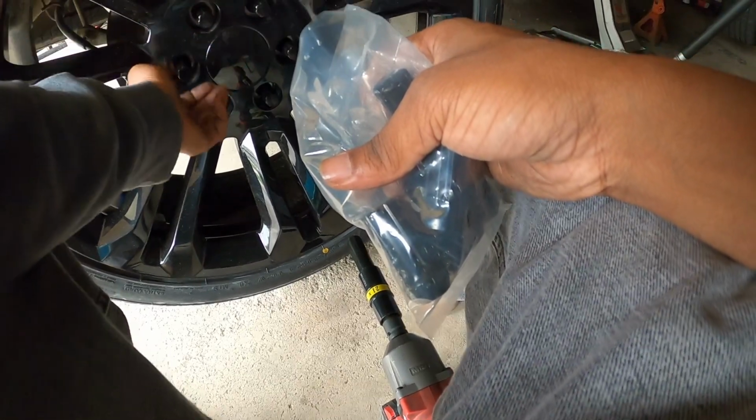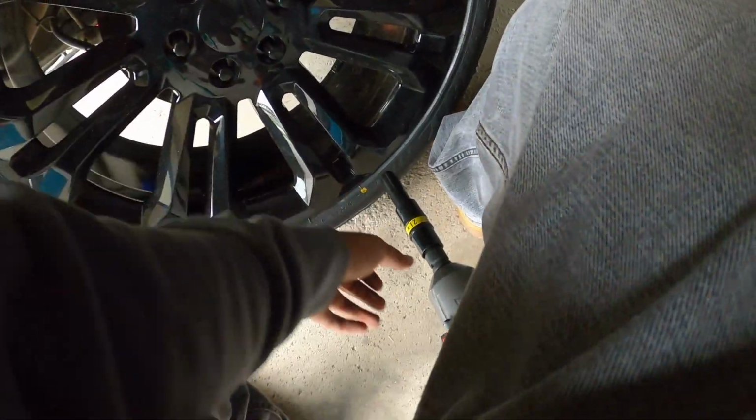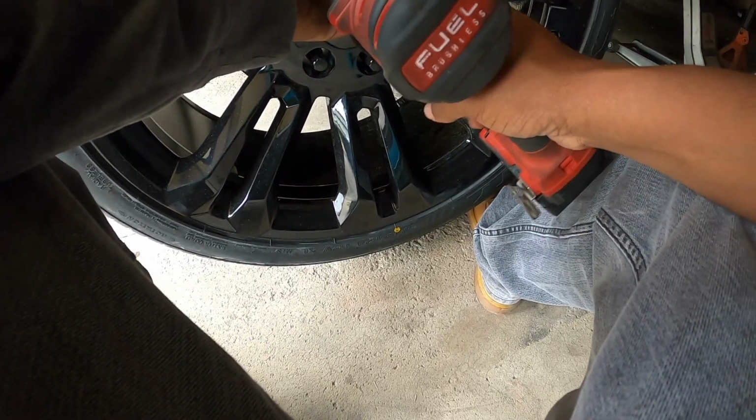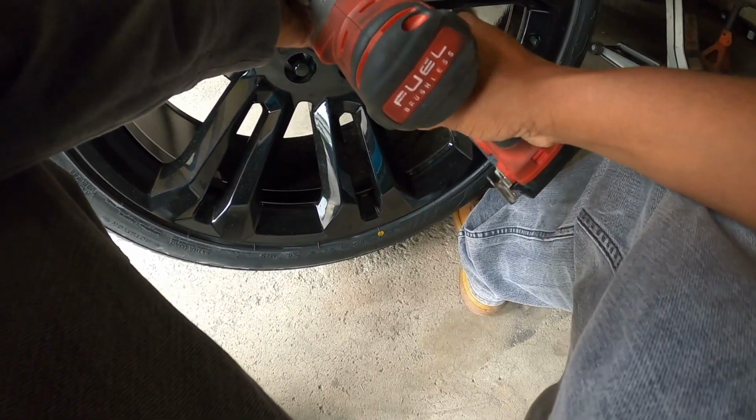Now I'm going to tighten these lugs with this impact gun. You're not supposed to do this because you can strip the locks. So don't follow me on that. Get you a torque wrench and torque them to 140 foot-pounds. That's the right thing to do.